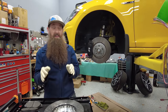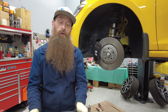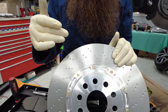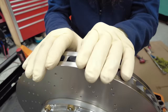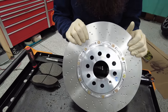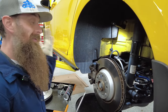Pretty simple upgrade — we don't have to fabricate, cut, or splice anything. Our main goal is to let our brakes do a better job of dissipating heat, and our rotor should help that a ton. This is actually a prototype rotor, so when the official version comes out the hat will be anodized and the outer edge will have a zinc coating. This looks a little different than what will be in production. Easy brake job — let's get at it. We'll start in the back.